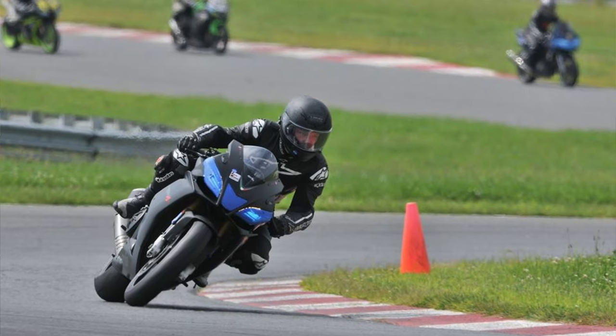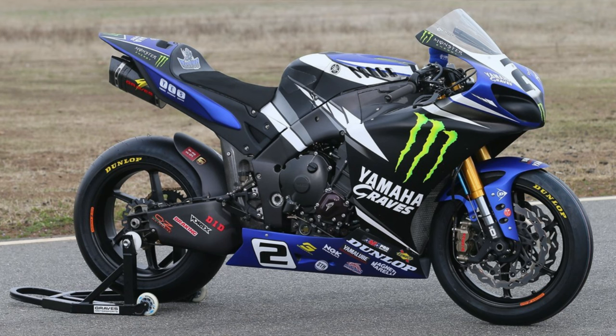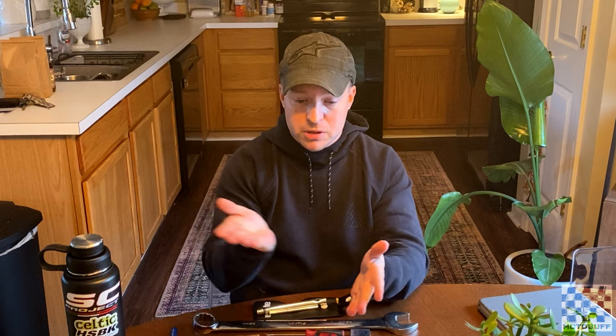Preload is going to be the focus of this video and how to set it up for your weight and riding ability. The other two we're going to talk on briefly, but it's going to be more of a feel thing — whatever feels good for you when you get out on the road. With setting your preload, we're going to set it for our weight initially as our starting point. However, a 170-pound rider who just started riding is going to put a lot less force into a suspension than a pro who goes to the racetrack all the time — that guy will require a higher preload setting.